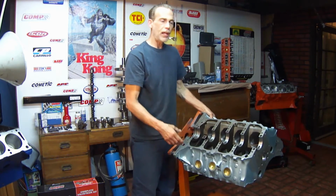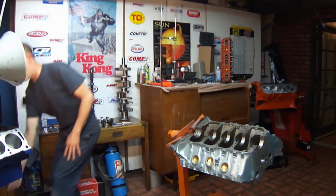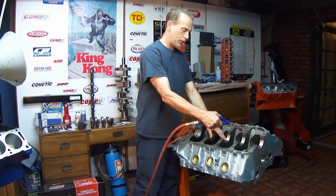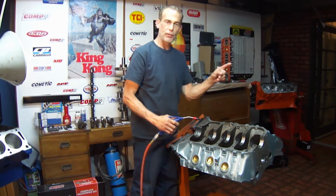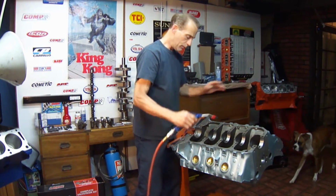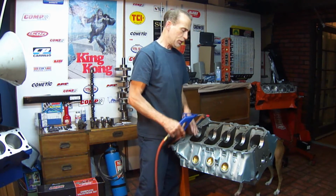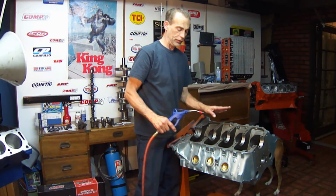After that, you have to have an air compressor with a blower, to dry the block instantly. Otherwise the machine surfaces will instantly start to rust. So you want a can of WD-40, an air blower, be right there when it's done, blow it all out, and everything will be great. You wait 15 minutes, it's going to start rusting, surface rust, instantly.